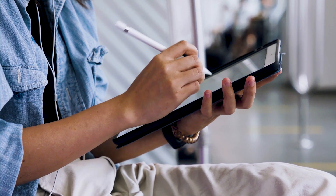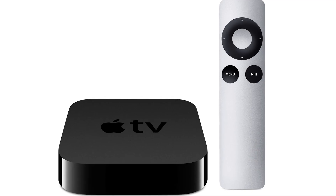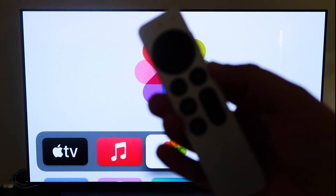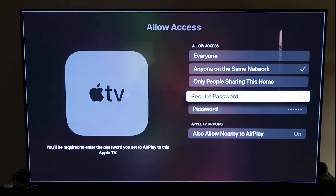The last way to mirror your iPad is probably the easiest of the three, but also the most costly — using an Apple TV 4K. I'll demonstrate with my iPhone, but it works the same way with an iPad. First, make sure you have your Apple TV 4K all set up, gone through all the installation steps, and attached it to your iCloud account. Then grab your remote control and go down to Settings.